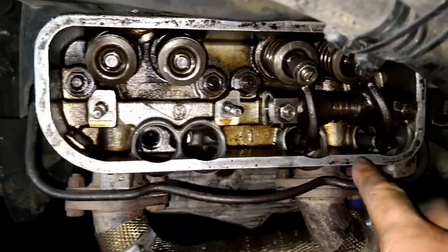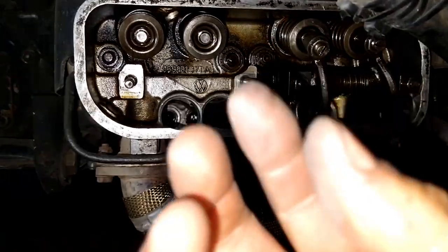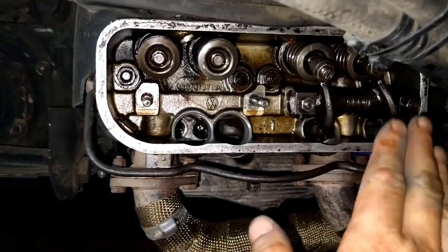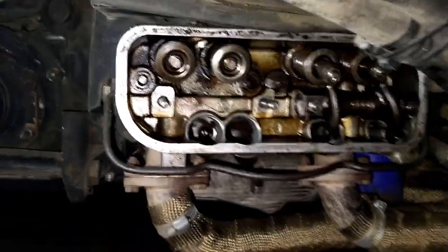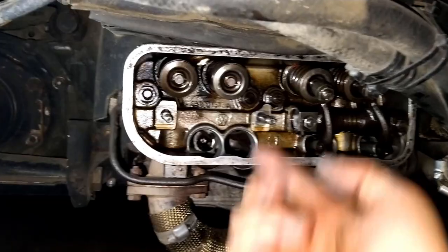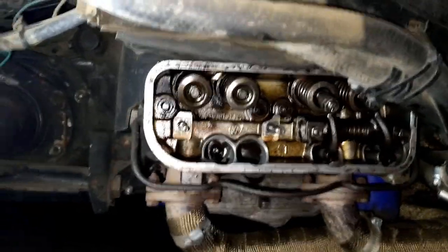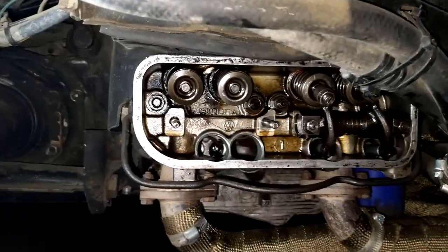Those actually went in perfectly. I didn't see anything come out, like pieces of flash coming out from the seal. So those hopefully will not leak, but I just learned this right now. So now you know. Make sure they don't have that sharp edge right here. Sand them off if they do. I'm going to go ahead and clean the back and put these on.